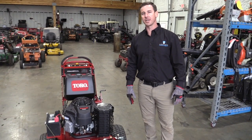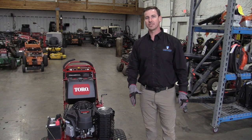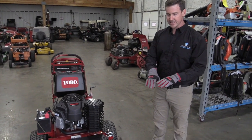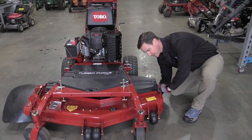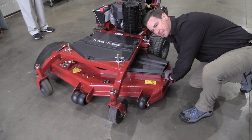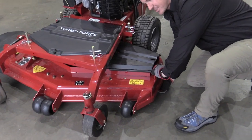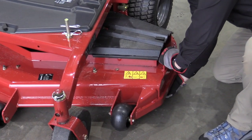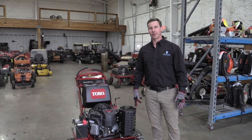The last piece of the pre-inspection is to make sure the blades are not broken, damaged, or bent. Make sure you have your Ace Hardware safety gloves on. You're going to reach down under the engine and run your hand across the front and back of the blade. You're checking for any chips, bends, or cracks, and also feel the inside of the deck to make sure there are no bends or cracks in it.